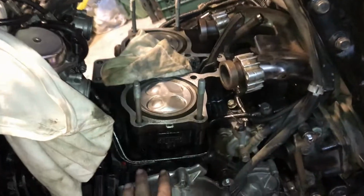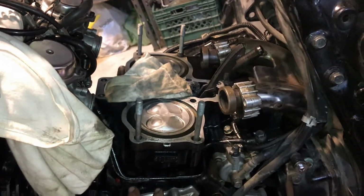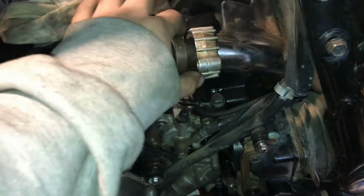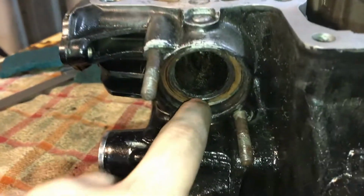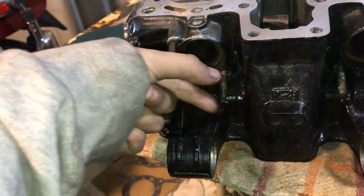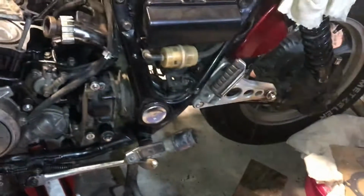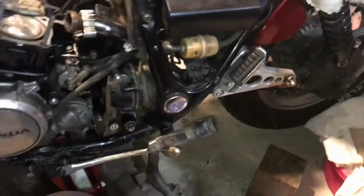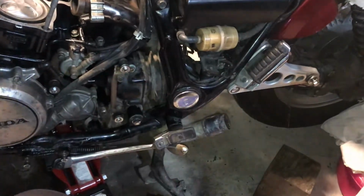You have to remove several components before you can remove the engine, so it's much better to do it the way I did. Another thing you should consider is that in order to remove the cylinder head, you have these exhausts, which go inside this place, no? So they will be a bit bothersome and complicate your life, and as well these things don't have enough clearance at first to come out this way. So what you should do is, first of all, remove both silencers as well as this gimbal here. They keep the whole exhaust system lifted up and unable to lower down.